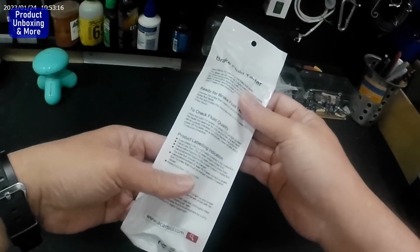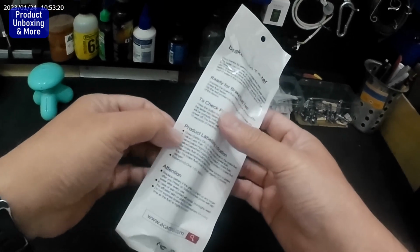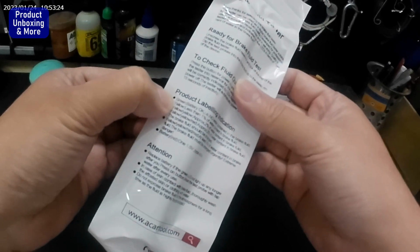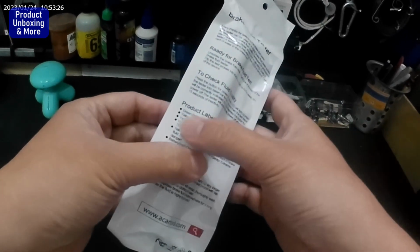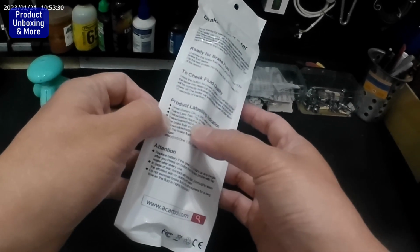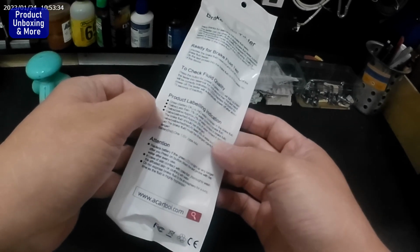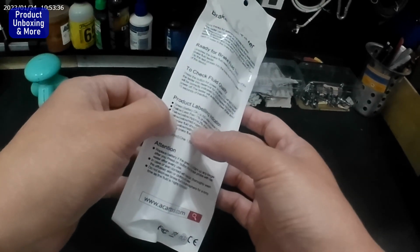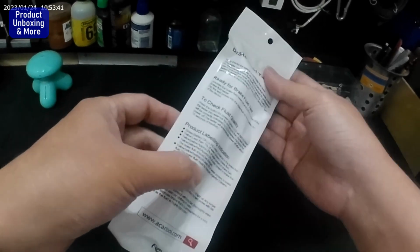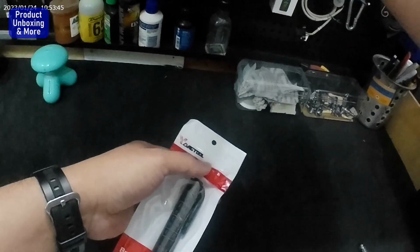So there's an indication here if the brake fluid is okay. If you see a green LED turning on, then there are also some yellow options, showing 1%, 2%, and if you have two yellows and one red, that's 3% water content. So anyway, I'll open this now so we can test.